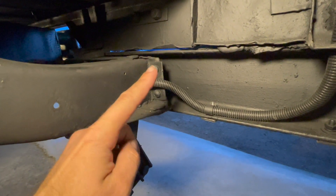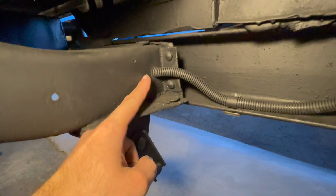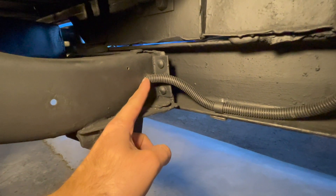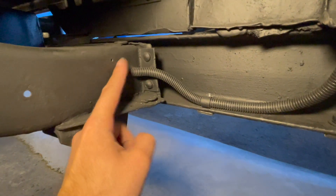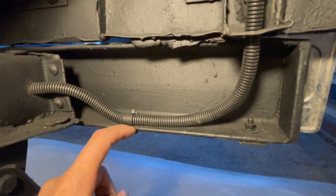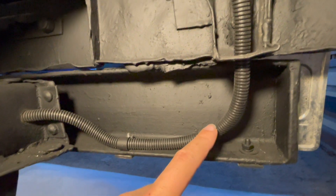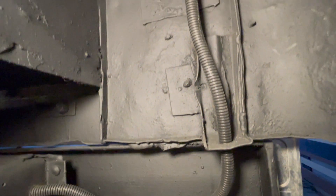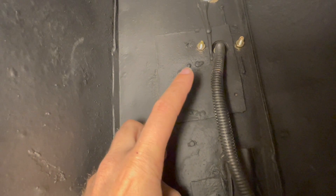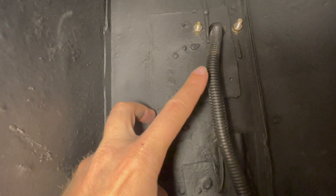I am now on the driver's side — do the same steps, but this wire will be considerably shorter as the actual main harness for the rear lights is located right here. The wires will go through your frame, feed them up along your rear bumper, and that goes up the tub and connects to your other light in the same manner as we did for the passenger side.